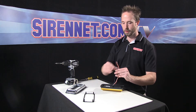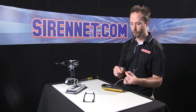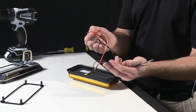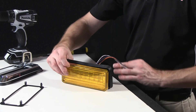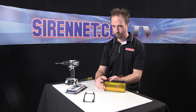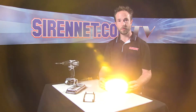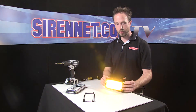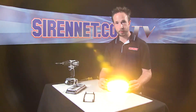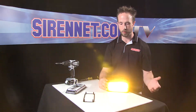We'll go ahead and light it up here so you can see how the optics inside and the optics on the lens boost the output. The amber unit has an amber — really orange — color trigger wire, and conventional black for the ground. Back up and flashing. You can see it's more potent and fills up the light head better. The lens also gives you a little bit of off-axis lighting, so in big applications like fire or rescue equipment, it's a great way to have lighting front, side, and rear facing with a little bit to the side as well for intersection protection.